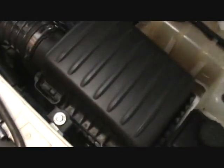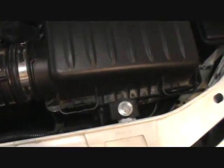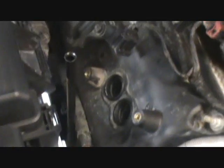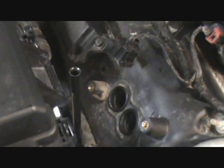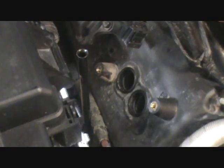Alright, then put the air cleaner box and air cleaner and intake tube back on. That screw right there for the air intake, and screw right there for the air intake, and it comes right off and goes right back on. So there you go, all fit, and the driver's side is done. Okay, that one was a little harder getting past the dipstick thing, but it worked. I had to use a swivel and a short extension to get in and out of there, and my hose.